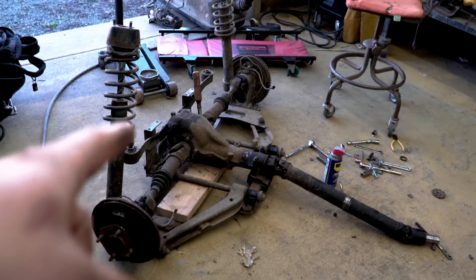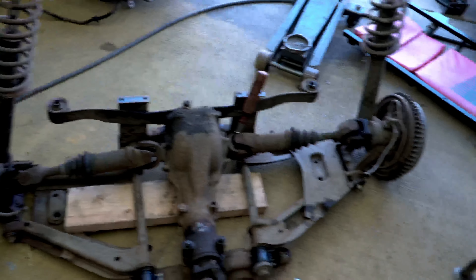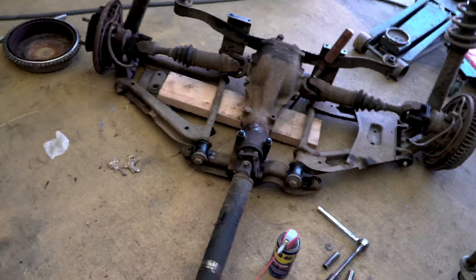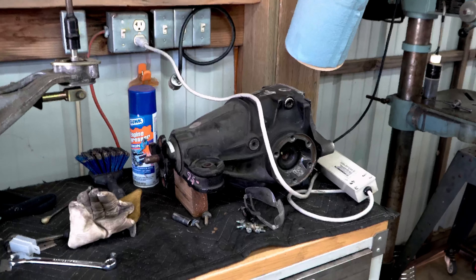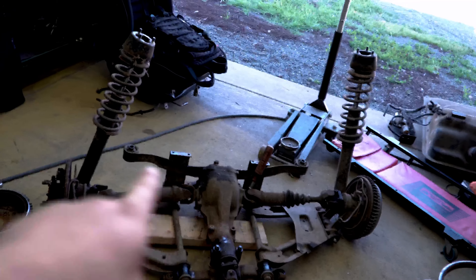The rear diff and basically the entire rear suspension is out. We still have the control arms, the diff, and driveshaft. I'm keeping the original brackets because I'm going to be doing different rear control arms, custom BC Racing suspension — the whole works. Then I'm gonna start fabricating a mounting position for the LS400 rear diff to fit on that back bracket so I can re-bolt it back in. The gas tank is getting sold today and we are pretty much bare under there.